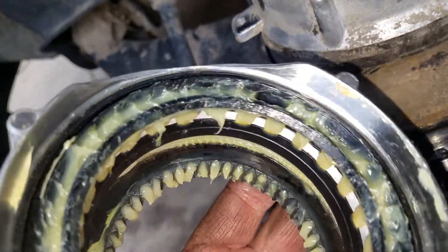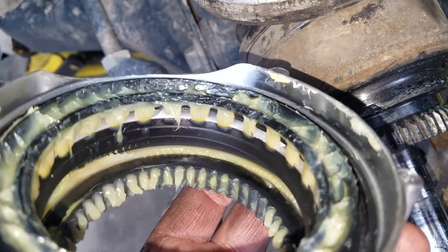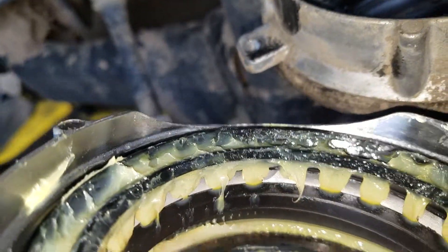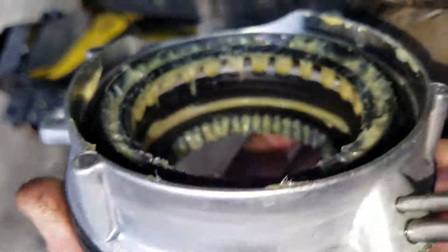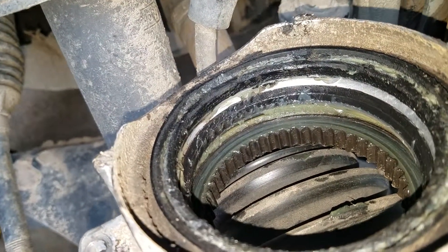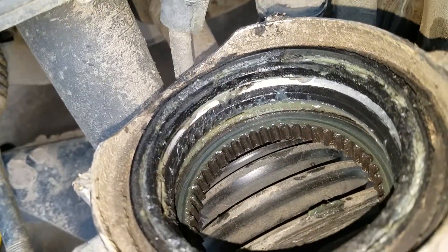Here's the brand new one and Ford just put grease all over it — I think their intentions are clear that this needs to have grease on it. You can see by looking at the old one and comparing to the new one that we have quite a bit of gasket erosion that has just burned that gasket off, ate it down pretty good. That's looking like the answer to what our noise is — that lip seal. I keep calling it a gasket, but it's a lip seal.